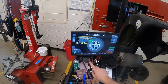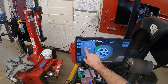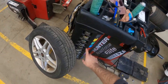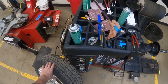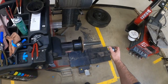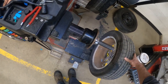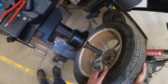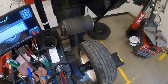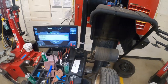Right off the start I'm going to put in the proper vehicle I'm working on today — a 2007 Pontiac Grand Prix. When I put that in, it's going to tell me which collet I need to put on the balancer. The light green one is right here, and I'll find out which side of it to use. After I have the proper collet on, I'm going to use the wheel lift to lift up the machine and get this into place. This isn't you being lazy — it's you being nice to the threads on the shaft. The lift goes up and down very easily, so I'm recommending you use it.